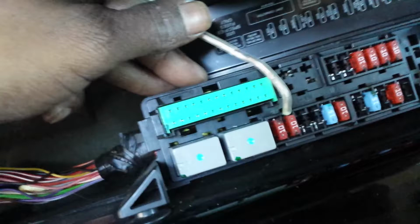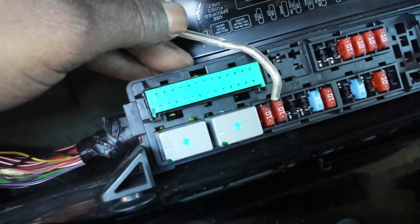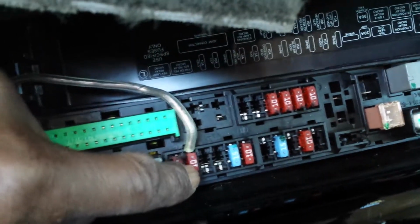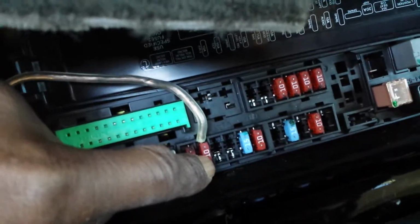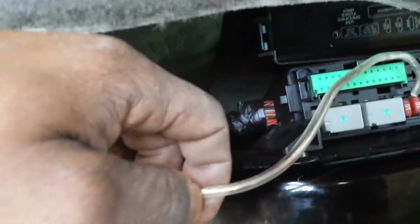Now you can see that plug that I use. That's the 10. So now you got your power, your ground, your constant power and ground, which is hooked to the cigarette lighter. Your remaining wire, you run the wire all the way around and you plug it into this one right here, which is your HVAC, which basically comes on and off with your car. What I also did with this plug was, for instance, if you tap in right here, you can run another wire from here, through the back to your trunk, and you can hook your amp up. That's your remote wire for your amp as well.